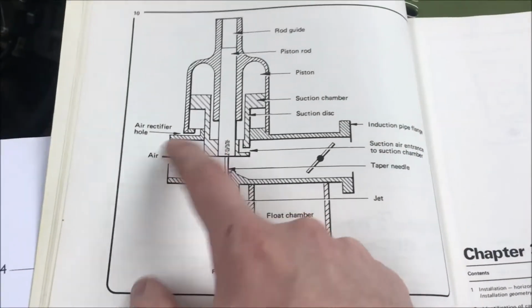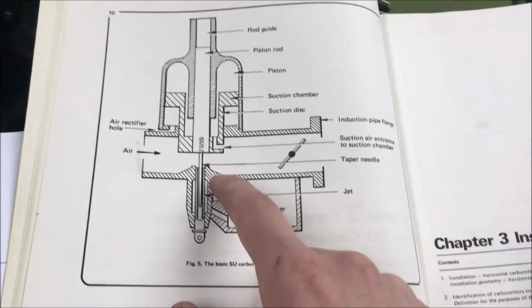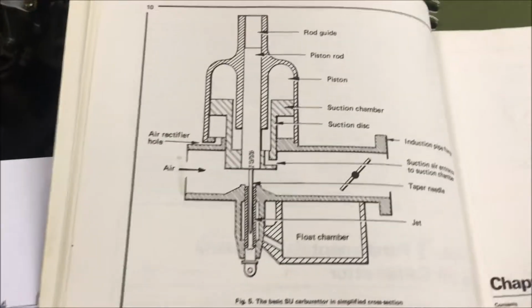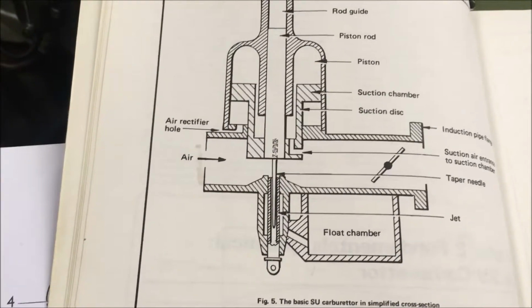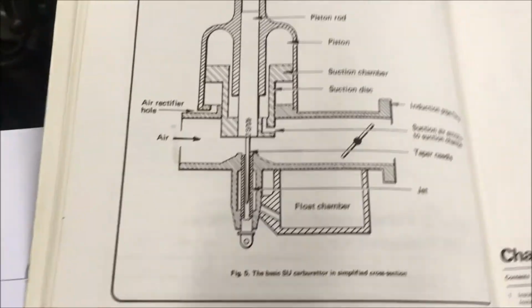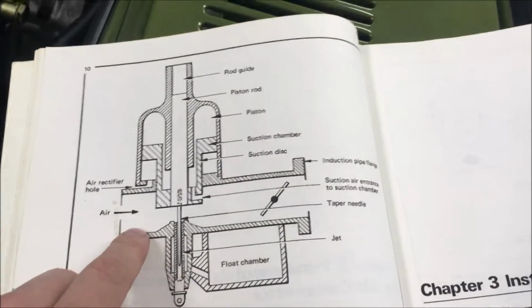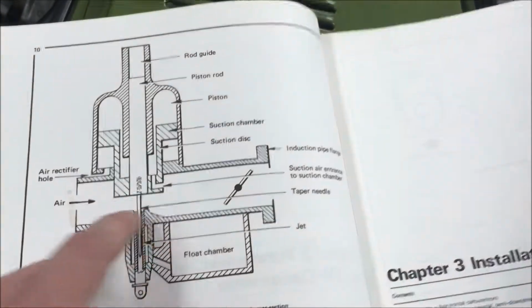So this pipe is relatively constant here in terms of width, and then it shrinks. There's a constriction in the pipe, meaning that the area where air has to flow through gets skinnier as it gets to this point. Now, if anyone's studied physics, you might remember that has some significance in pressure, and it's a principle called the Venturi Effect. I don't know if it's a principle or whatever the proper terminology is, but what it says is when you have air flowing through a pipe and it features a constriction like that, the fluid pressure reduces, and also velocity will increase.